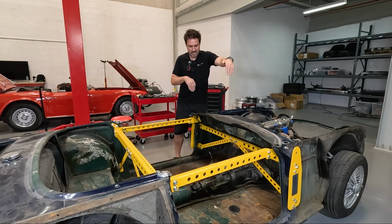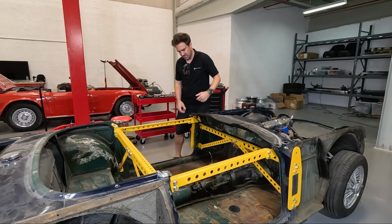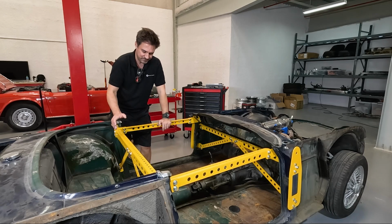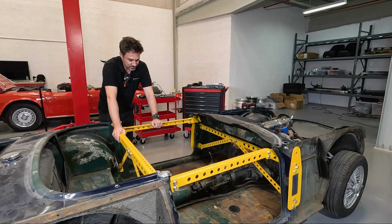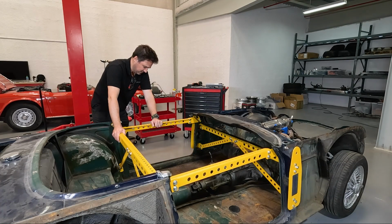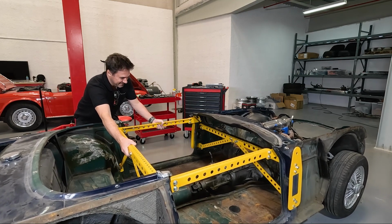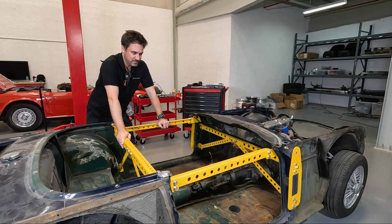So that any up and down and left and rights or any lateral forces when you lift it up stay in that assembly of those elements, rather than it troubling the body shell. And the same principle then exists on the B pillar line. So with all that in place, it probably seems a bit daft, but it's incredibly stiff with all these elements in.